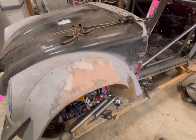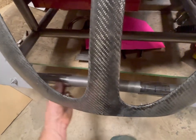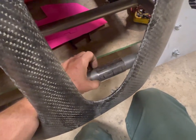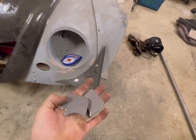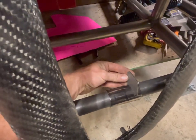If you guys noticed on the last video, the hood is back on the bug. I have a ratchet strap holding it exactly where it needs to be. I have this bar down here that goes across - as you can see I have two sliders on it. Went ahead and got those cleaned up. There were these flat plates welded directly to them, so I cut those off and cleaned them up so they're all nice and clean. I also cut these out of steel - these are eighth-inch steel plates, got two of them made, and these are going to get welded on here.